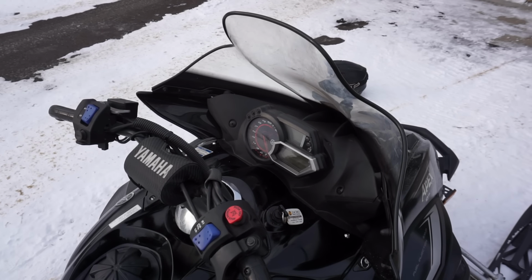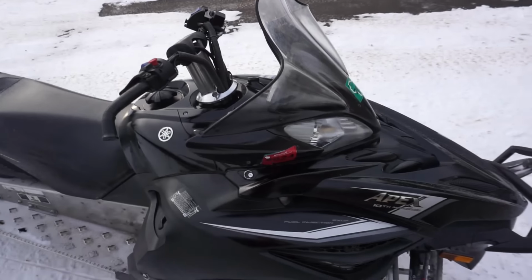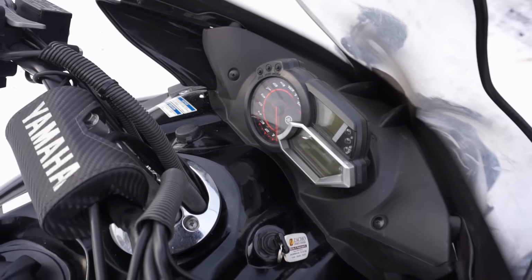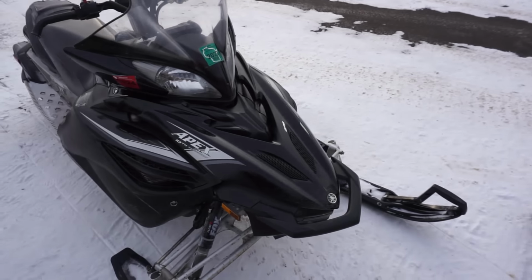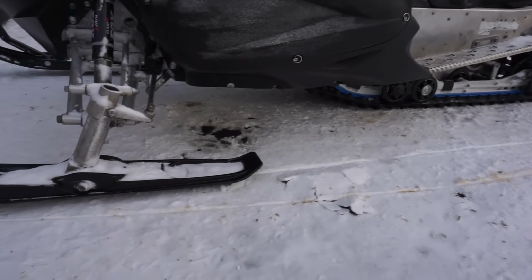If that comes on, it limits the throttle response, so it won't go over 3,000 RPM. And you can watch the needle. It like won't go over 3,000 RPM. So it's not going to go very fast with that knock sensor out of there. But I'm really surprised it moves as good as it does.